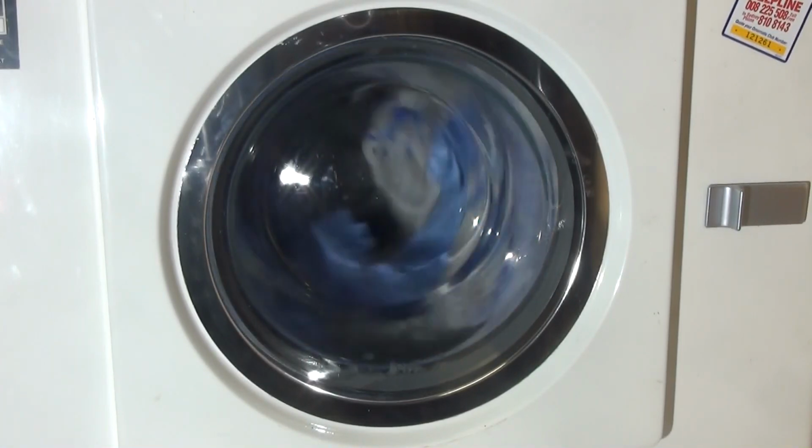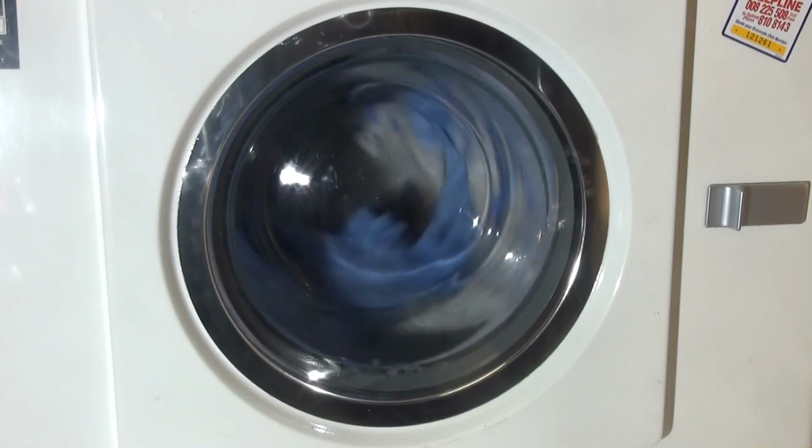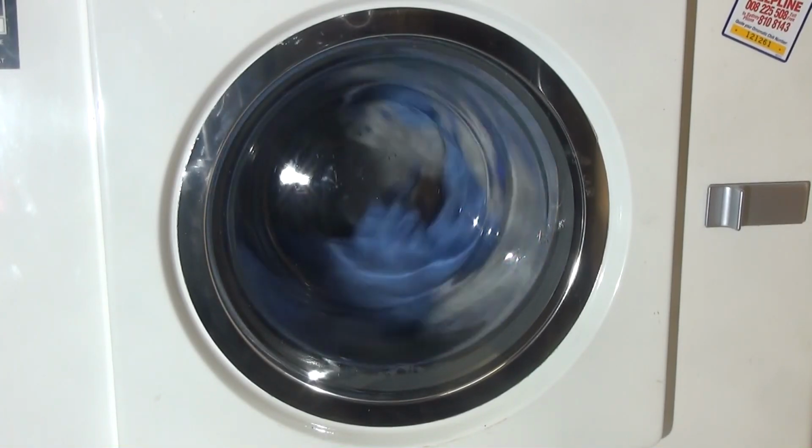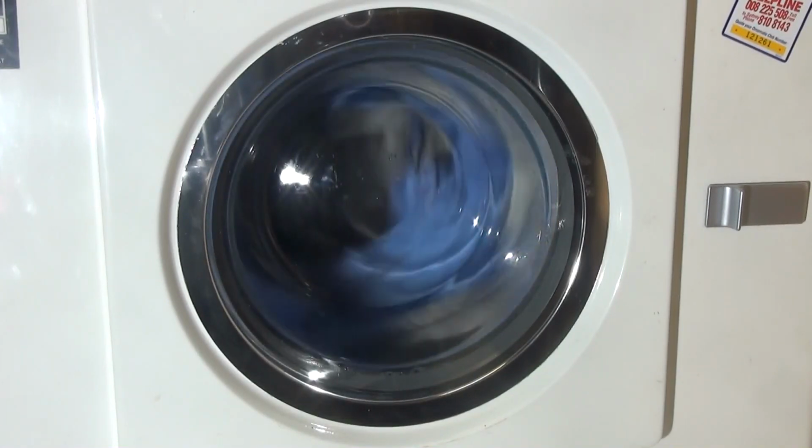Does it tumble on the rinses though? Yeah, it does the same. No, not in the rinses. No. Same delicate tumble for the whole thing. The spin. Bosch is just as bad. The intermediate spins. The Bosch was the worst one I've ever had. The intermediate spins are 600 and they're a quick burst, and it doesn't give the machine enough time to pump out. I don't think it's actually supposed to, actually. No. But the worst wool cycle I've ever come across was the one on Bosch Logixx.